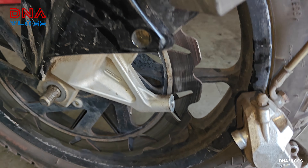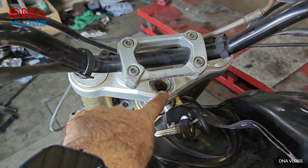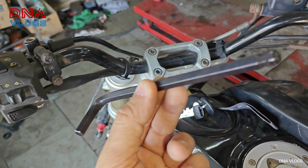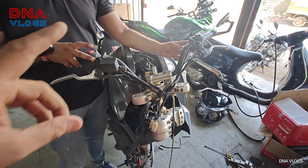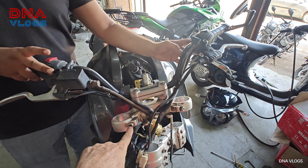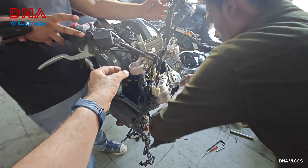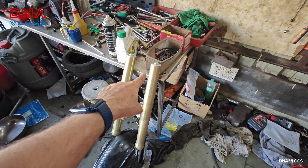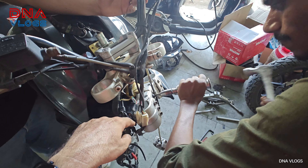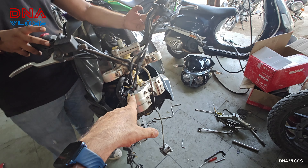The axle is loosened, the caliper has come out, and the nut bolt has been taken off. We used an angled allen key to remove the bolt. We've removed the fork tubes — we loosened the six bolts, which increased the gap. We put a screwdriver in, the gap increased, and the tube just came out. The center bolt is tight, so we're removing it with a punch.